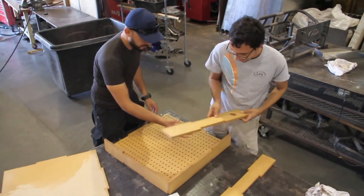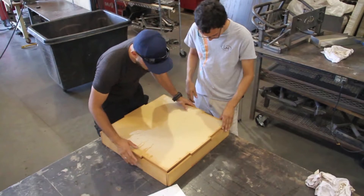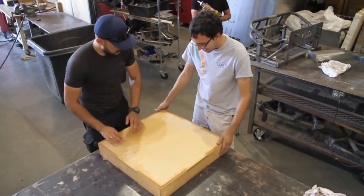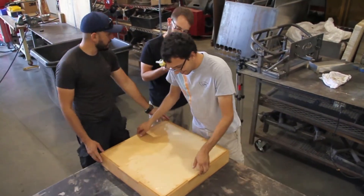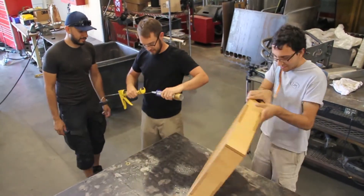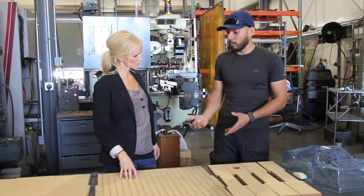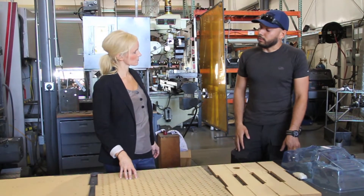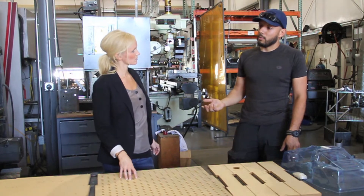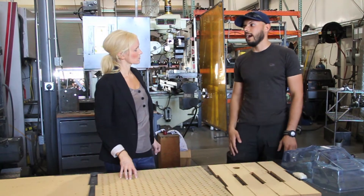This was formed using MDF, relatively affordable at any hardware store, and it was cut in minutes. This is just another way to see what we can do to focus on Rally Fighter production and possible other vehicle production. For example, the dash — we would like to explore thermoforming plastic parts on that rather than the standard fiberglass model, mainly because we want to do cooler shapes and things like that.